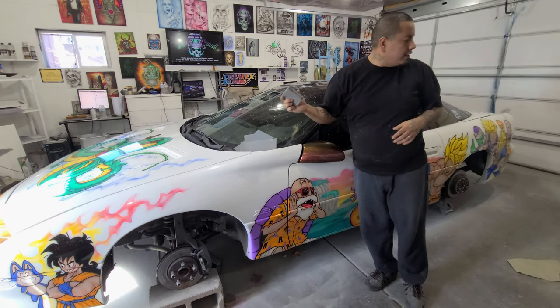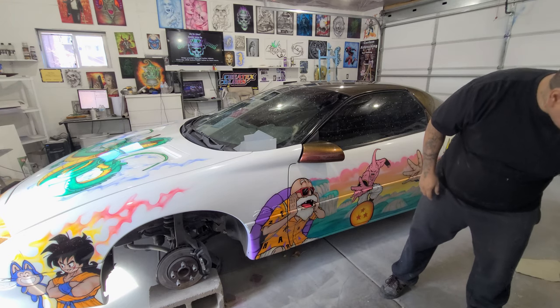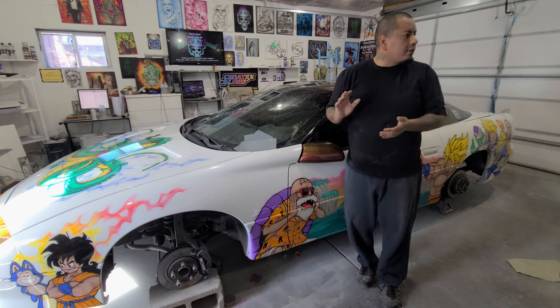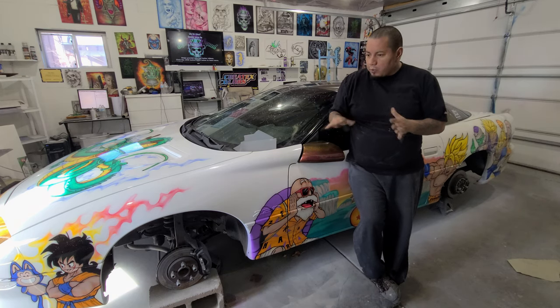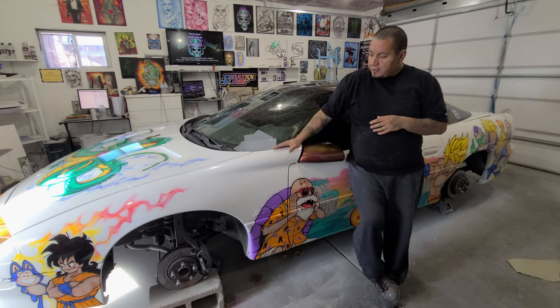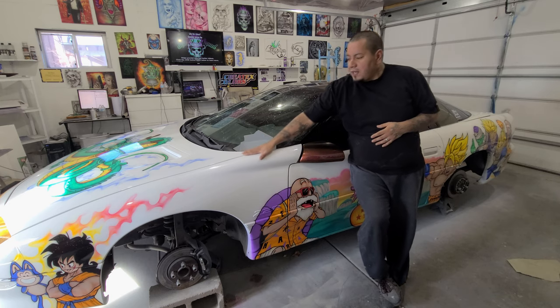I would watch out for these though, but my Dura block is not here. But the Dura blocks are really good. They also have vinyl blocks nowadays, which are really, really flat. Having one of those helps. You also have to be careful with those, as you could run through the paint in certain spots. When you're doing this, you want to be careful around all the edges.